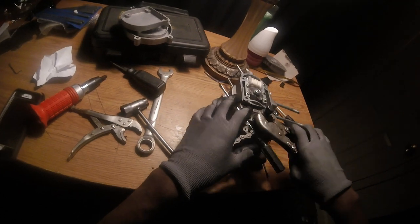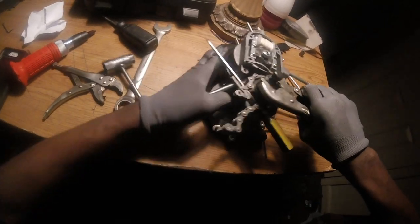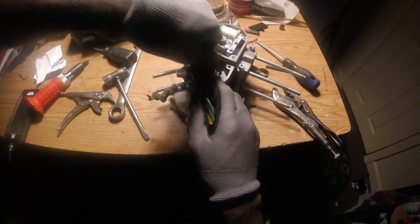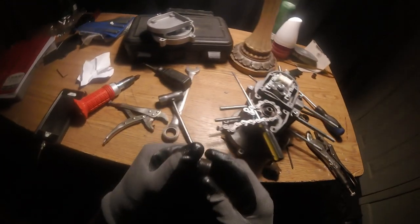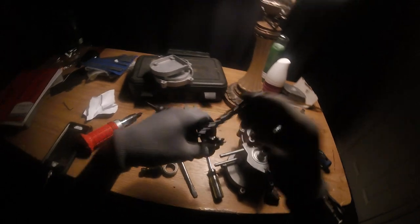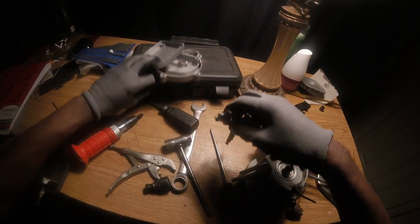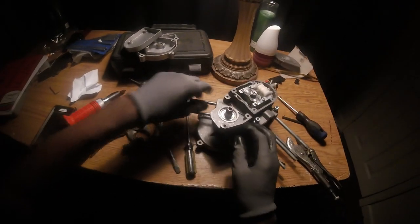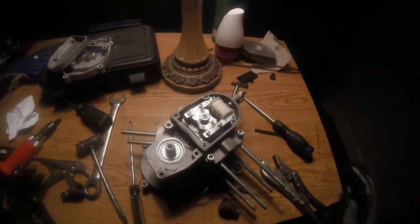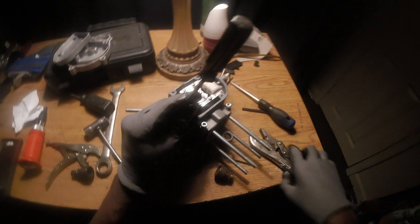Now we about to unscrew it after we broke it, because we're gonna have to use that tool again. So it's about 5 full turns. Okay. Now you want to put your sprocket up safe. If you're using a full chain or a half chain, you put that up. Also, your Woodruff key. Be careful when you taking your sprocket off. Sometimes it'll get stuck on it. A lot of times you gotta knock it out because they glue it in there.